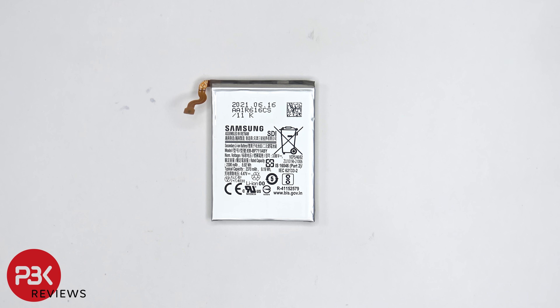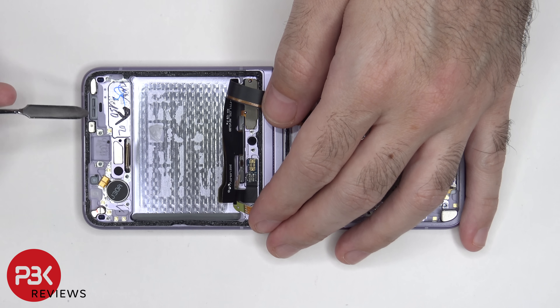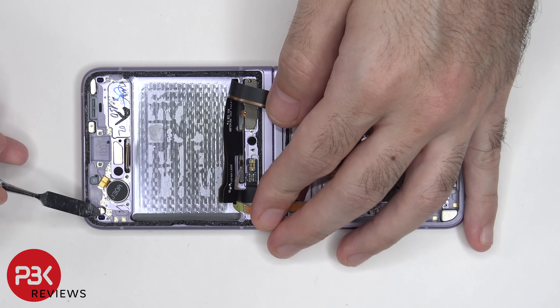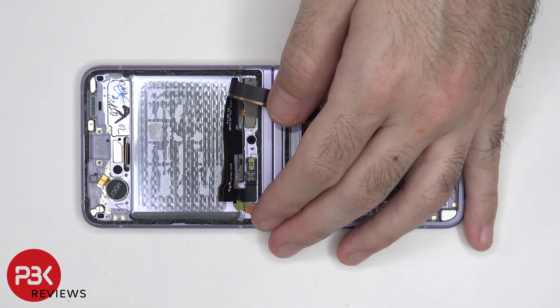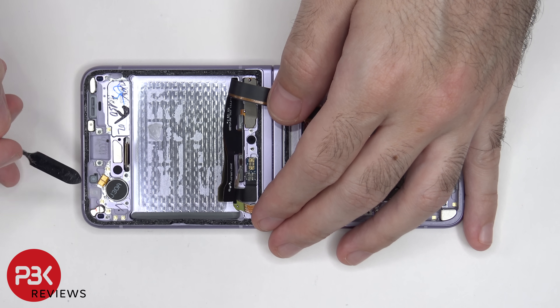Here's a better look at this battery. On this side of the flip, there are four magnets — one located here, one over here, one on this corner, and one on the other corner. The foldable screen cable runs through this opening over here. The vibrator motor is located right over here and is held down with some adhesive. There's also a rubber gasket over here for the speaker opening and one over here for the microphone.